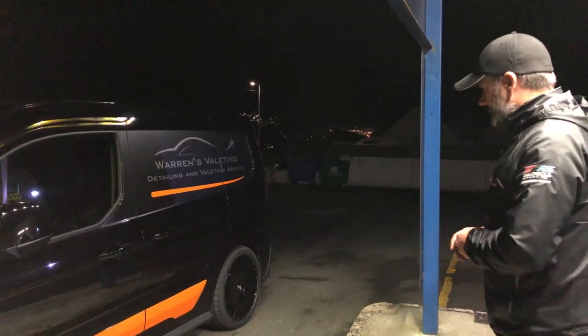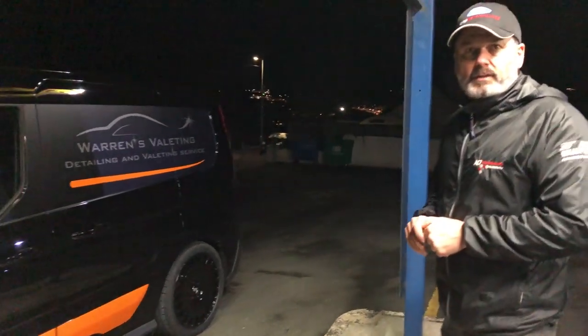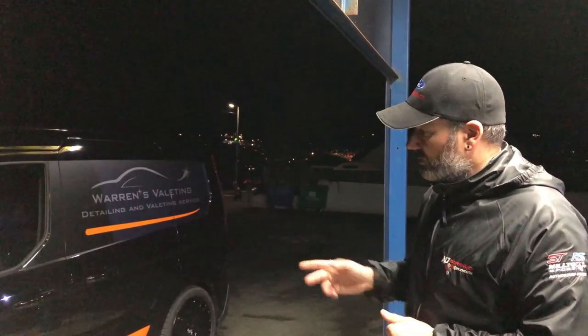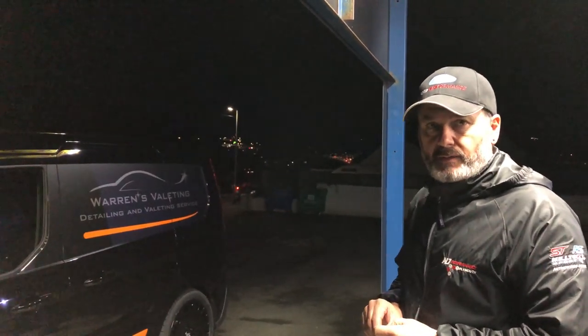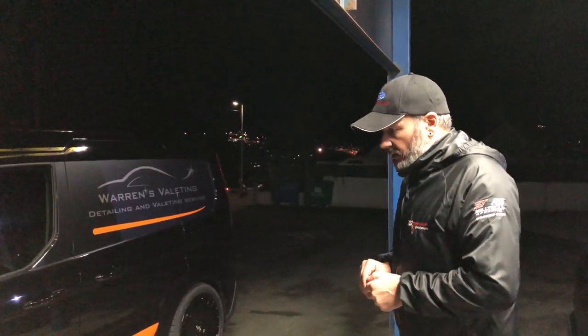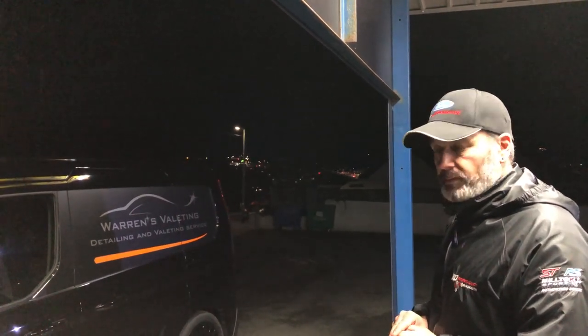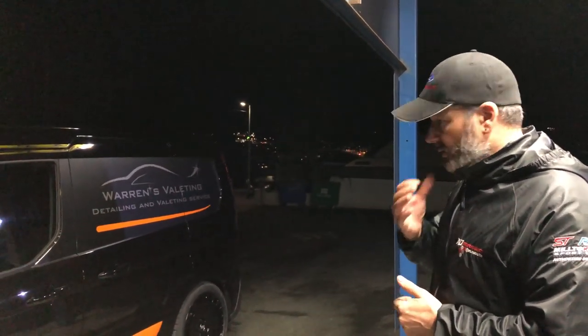245/40/18s on it. Tim, you just took the road test, didn't you? Yeah, and it's all pretty good. No horrible noises on lock to lock or over some of the sleeping policemen around our area. So, all good, yeah? Yeah. So what we'll do is get John to bring it back in a week's time when everything's settled in. We'll sort all the alignment out then, do a geometry check on it, and make sure it's all running true, because what you don't want to be doing is scrubbing all the tyres out. Obviously it's going to handle a bit differently with the lowering springs, much better. But with the 245s on it, great.